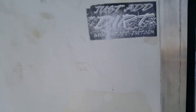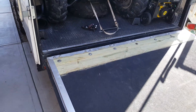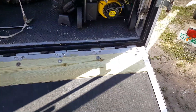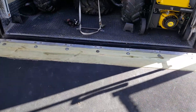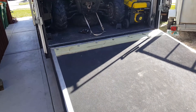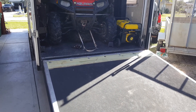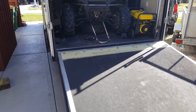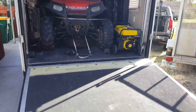We're back — time to test out the door and hopefully it does not snap off on me. Repair complete! That makes a huge difference — no more flexing down there, it's solid as a rock. I had to go fix the crappy factory job on this toy hauler and put a two-by-ten down in there and screwed it all together. Not a super fun project but I got it done and I'm very happy with the results. Make sure you subscribe and keep watching — hopefully I've got something to help you.